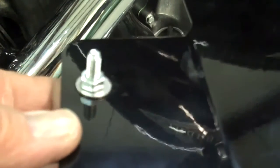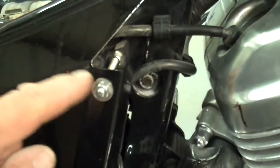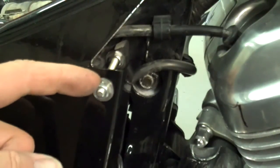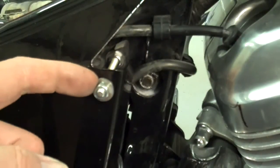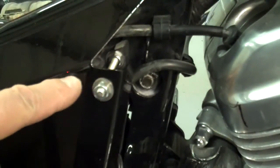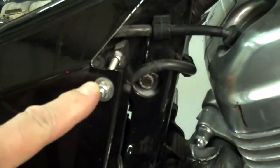It's time to mount the side cover. On the back flange of the side cover we have a nylock nut — leave that in there because it's a captive nut to keep the screw from coming out. When you tighten it, that captive nut can go into the rubber grommet, which is fine — it kind of seats in there. On the front stud, go ahead and put two or three washers on there to space it a little bit. Then run your nylock nut until it's just past the threaded stud — you don't want to run it in too far or you'll have a sharp edge.